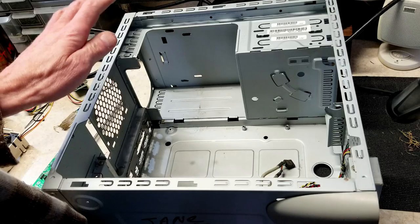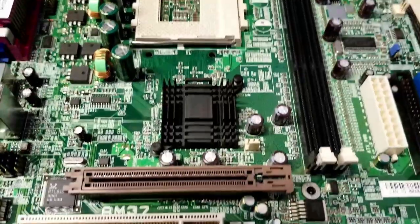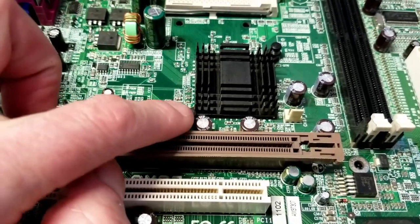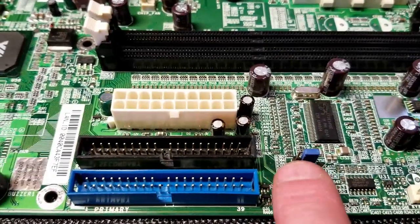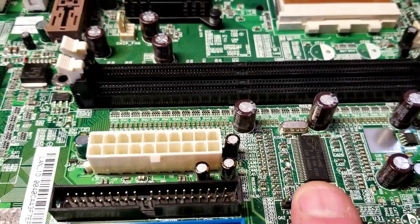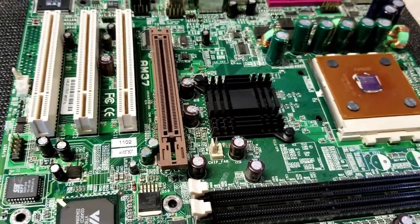I stripped the last few parts out, got everything cleaned up. The case parts are washed and drying — scrubbed with hot soapy water. The motherboard I brushed off and hit with a little denatured alcohol. I tried to take the chipset heat sink off, but it's like cemented on, so I'm not going to try. After a little research, this is the VIA 266 chipset. This jumper switches between 100 MHz and 133 MHz FSB — 266 MHz is the highest bus speed this board supports. So we went with the Athlon XP 2000+ in here.